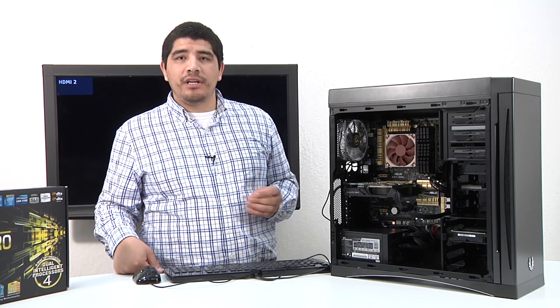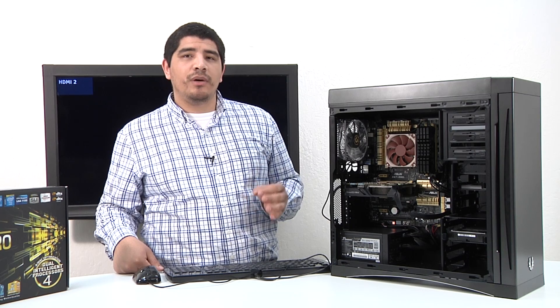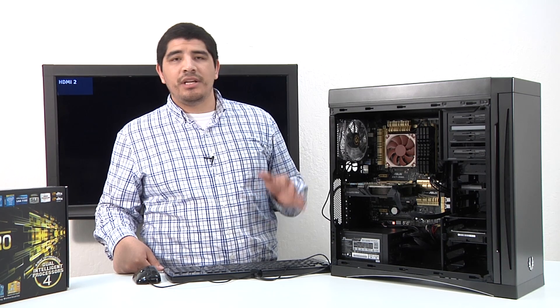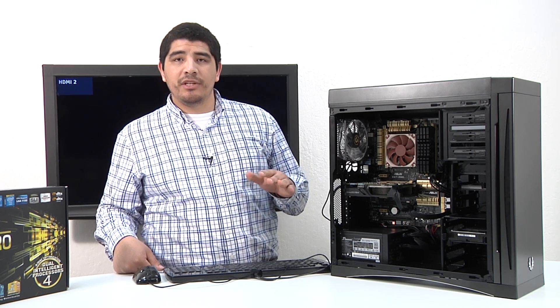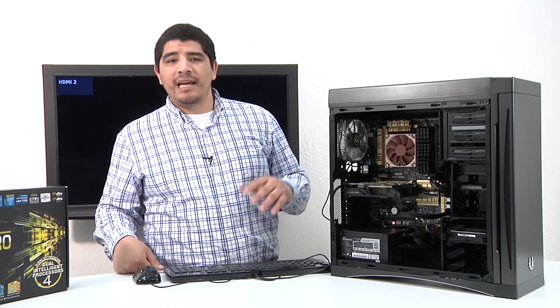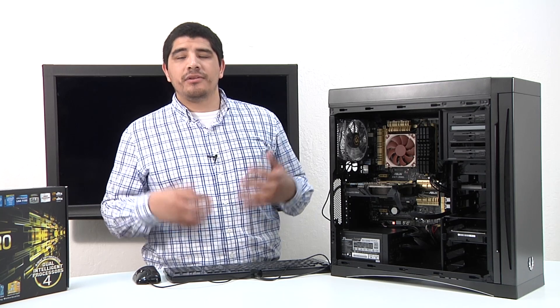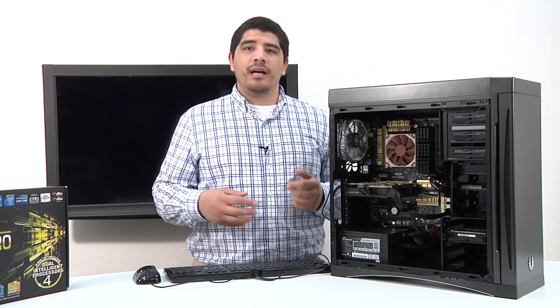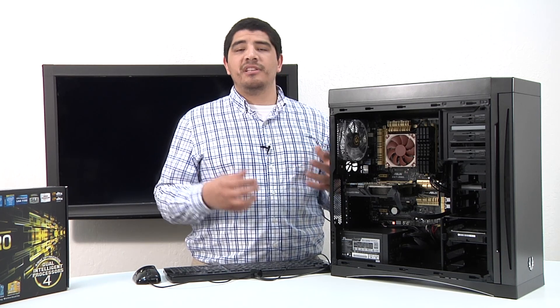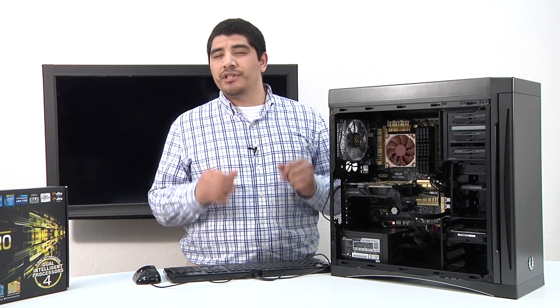We didn't cover it in this video, but if you really want to be super safe, it's generally recommended that for a basic POST test, you go ahead and install the CPU in the motherboard, put on your CPU cooler, put in the memory, and essentially test everything outside of the box first to see if the system responds. This will, of course, save you a lot of headache afterwards if there ends up being a component that's been damaged or compromised during the installation process, at least helping you know that originally everything was working.